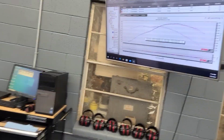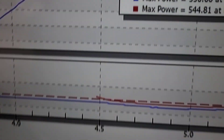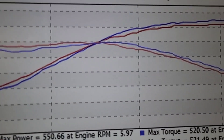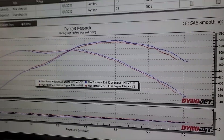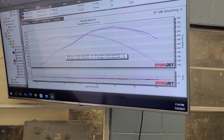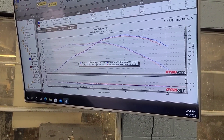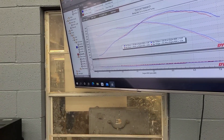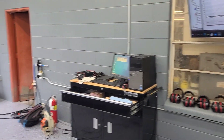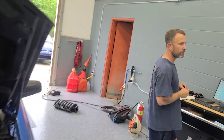Especially above 4,500 to 5,000 RPM — this car has a high stall speed converter and it actually stalls to about 4,700 with this setup. So these numbers may be slightly skewed from that. Anywhere above 5,200 it picks up, and that does require tuning. You cannot just throw on the ported intake without a retune. If you ran a ported intake on your stock setup tuned for the stock intake, you would be extremely rich everywhere because it's flowing so much more air. Your mass airflow is going to overcompensate for fuel, and you would be rich and probably slow down at the track instead of speed up. So make sure you talk to your tuner and engine builder to get it dialed in once you swap the intake.